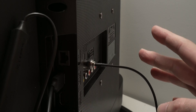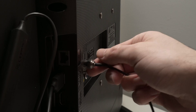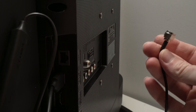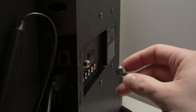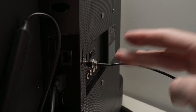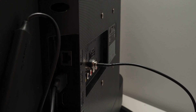Another thing you can do is go to the back of the TV where the antenna connects. Mine is connected here — disconnect it. If you have a cable box or another device instead of an antenna, disconnect and reconnect that, and make sure the connection is secure. If you have this connected to a cable box or another device, make sure that device is turned on as well.